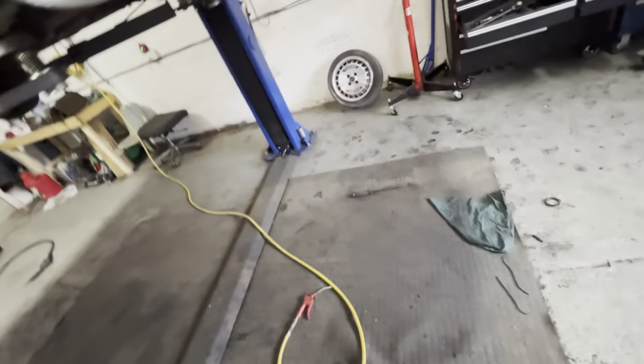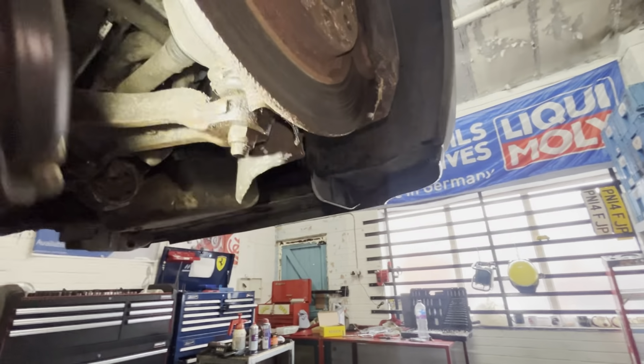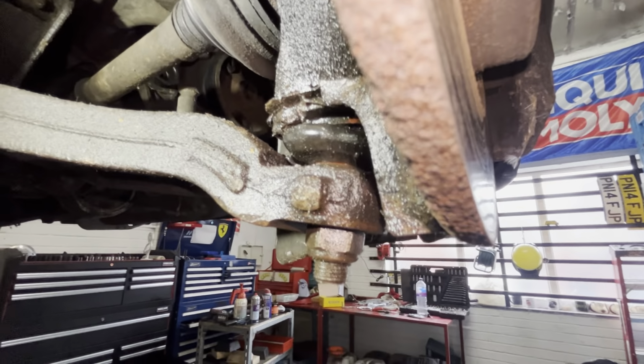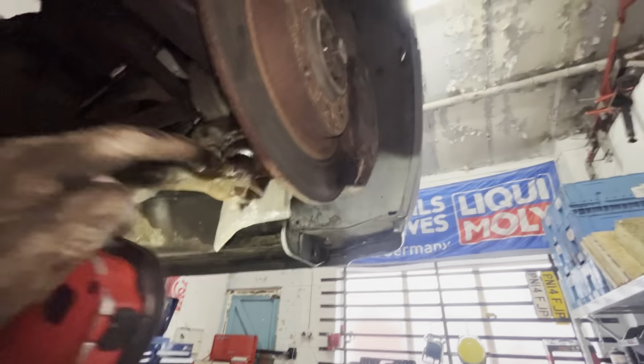That means all that'll come off. Ball joint is getting changed, but will the lower arm come off? 100% will it come off. Piece of cake it will. So you can see here, it's got some hammer marks already. Therefore, that means that that's already been off. And it probably already has a new ball joint on it. So if that's been hammered before, this arm will come off.